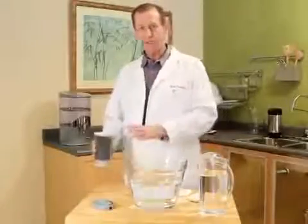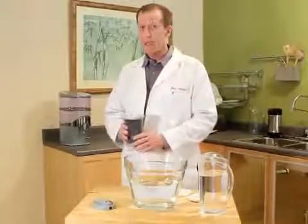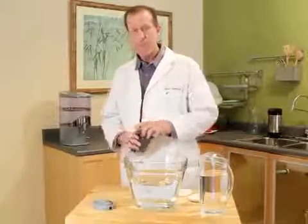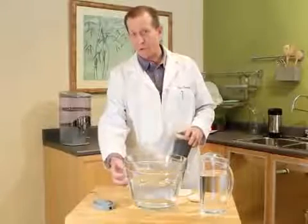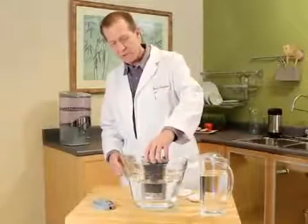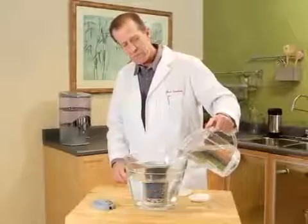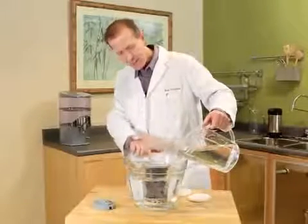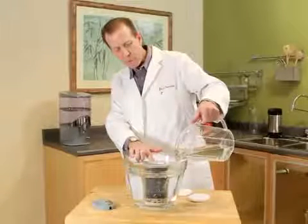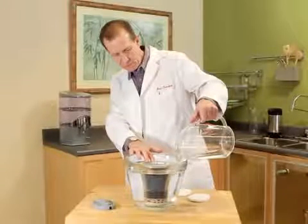Now we're ready to perform the pre-soak procedure. Now this is something that you'll want to do with the new filter when you receive the unit, and you'll also need to do this every time you replace the filter with the replacement component. For pre-soak, you need a bucket or pail or whatever receptacle will hold water enough. You put the filter cartridge in and you add water until you reach a level that is just under the top of the filter. In other words, it'll come up right to about where that rubber gasket is. And that's the appropriate fill level.